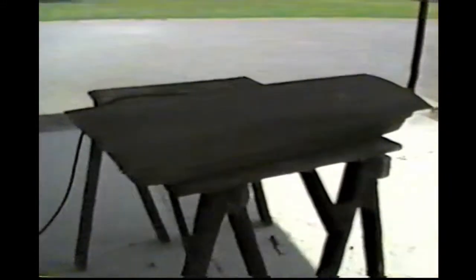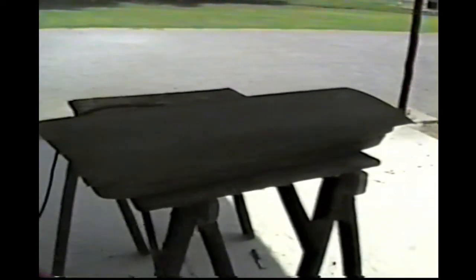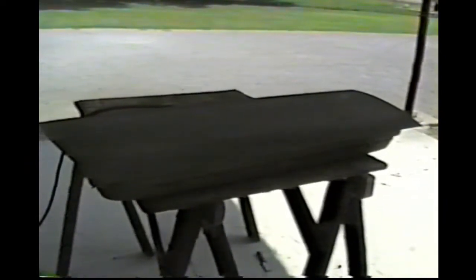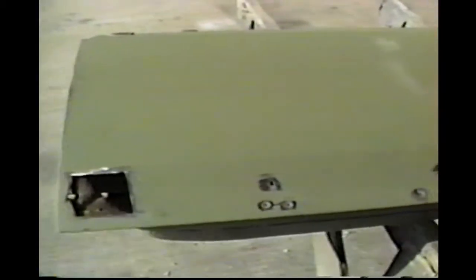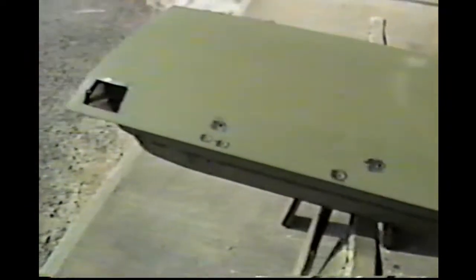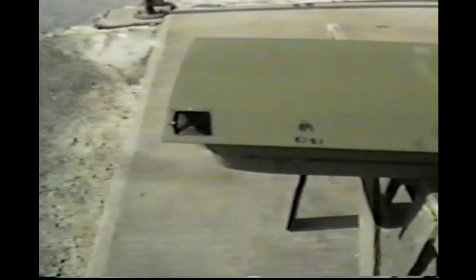So I located another door. That way we'll have two good solid doors on the car. So I'm going to continue putting the green on this door, and I'll pick that other door up tomorrow. Weld those holes, which is all right. It also had a bit of rust in the corners, so I'm going to patch and repair, put patches in here. The corner on this one is real good. So we'll have a couple of small patches in the corners, and we'll have a real good door.